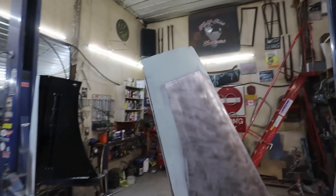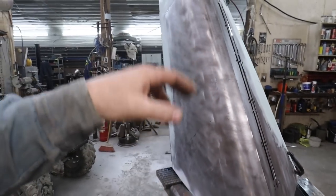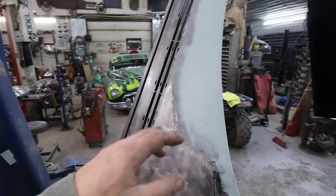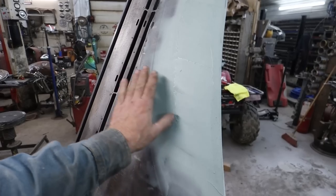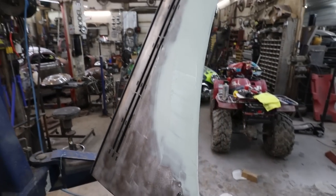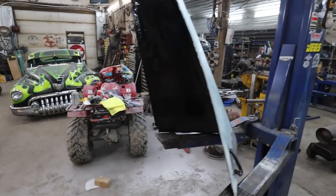Alrighty, we got our second coat of mud on. I kind of stretched it over a little further. It was okay, but when you're sanding, I find if you smear just in the area you need, by the time you sand, you screw up the other spots. So I kind of just gave everything a skim, filled what I needed, gave everything a skim. We should be good.